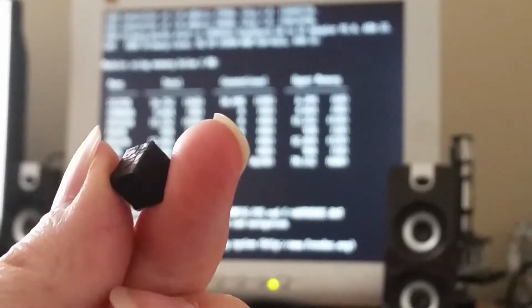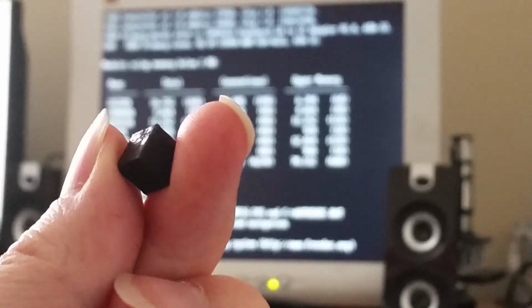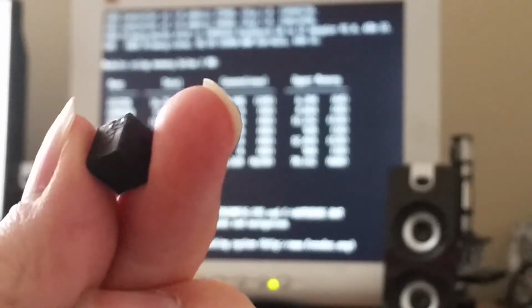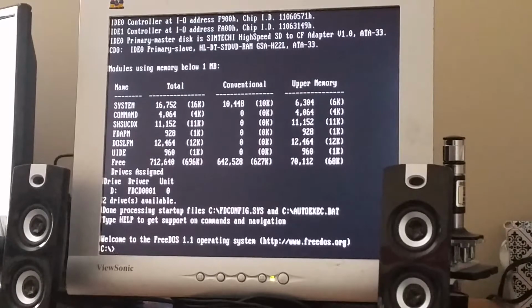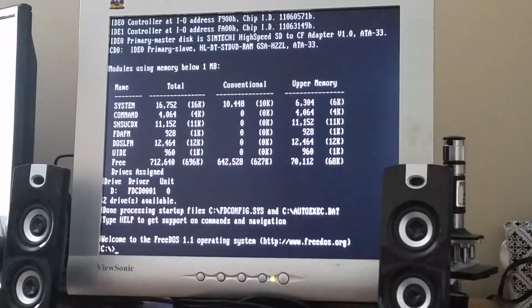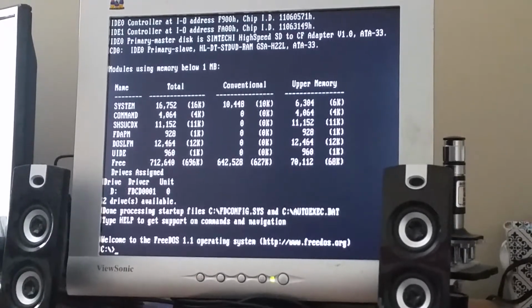And I can see a little bit of glue right there in the light. A bit of just old dry glue that broke off, and a tiny print from where the spring used to be. So I think the manufacturer of the drive, MPI, actually used this in order to make the spring's tension be able to hold down the read head better. So that's going to be a little bit interesting if that really is the case. And that would also mean that I don't have to 3D print anything. So anyway, let's put the disc back in.